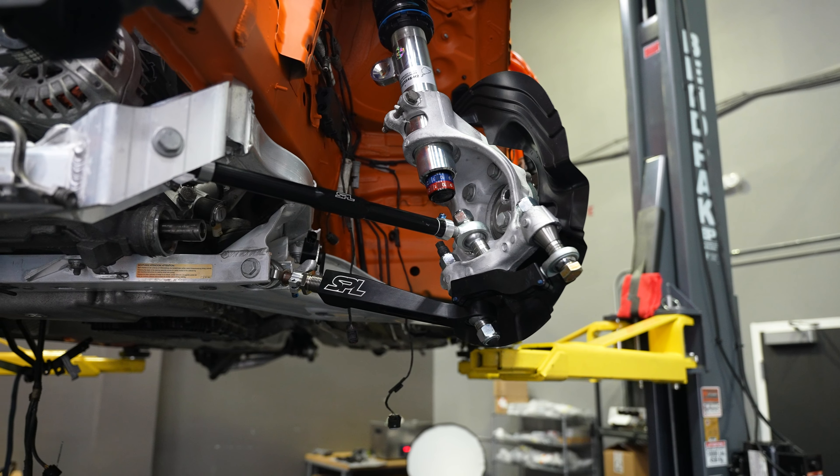At this point in the build, we're onto the other chassis modifications to pair with the coilovers: the complete suite of SPL arms for the front and the rear, and we're also reusing the E9X M3 sway bars in the front and rear. Adam mocked up the front — we have the front tension arm, the lower control arm mounted up, and the adjustable tie rod, which will go onto the steering rack when we install the rest of it.